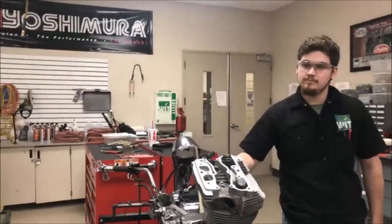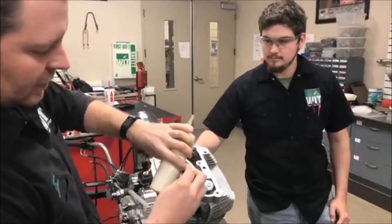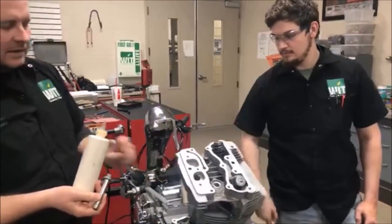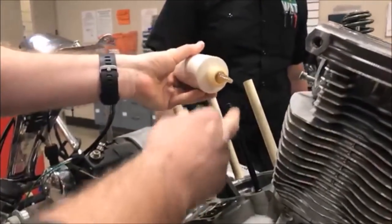Yep. So what they're saying is to properly install this, you want to put oil on the shoulder, is what Harley Davidson's call that. Some people call that the face of the bolt. And then look over here to one that we've opened or exposed now. And then you'd want to put a little bit of oil on here on the threads.